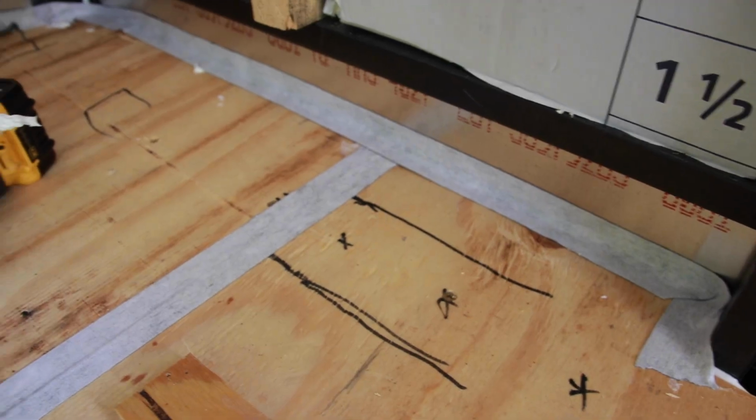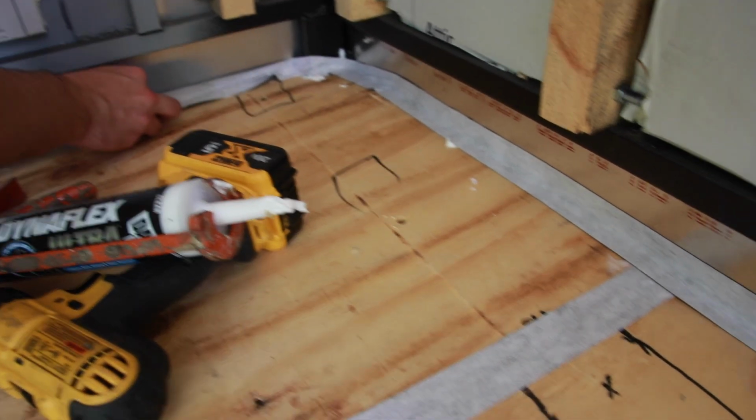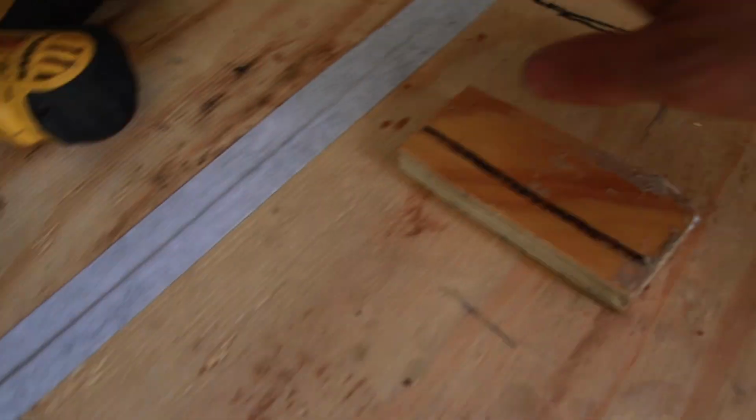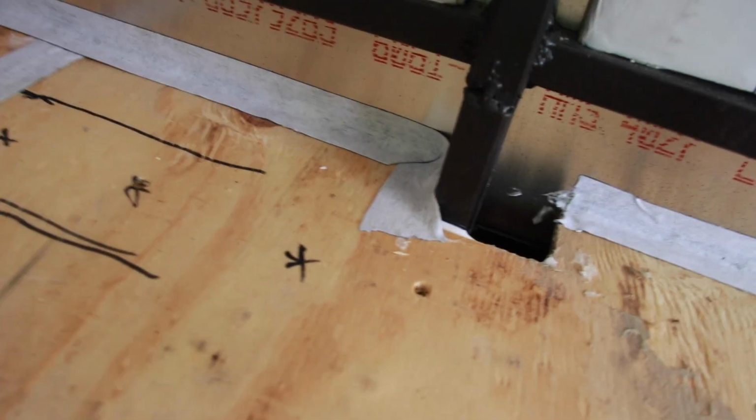Heck yeah, boy. All right, we had a bunch of corner sealant tape left. I think it's a Dicor product. Since we had a bunch left, we decided to seal all the way around each corner and then wherever there was an overlap. Notice the screw placement all the way down. We ended up using a common decking screw. It's coated and prevents rust.